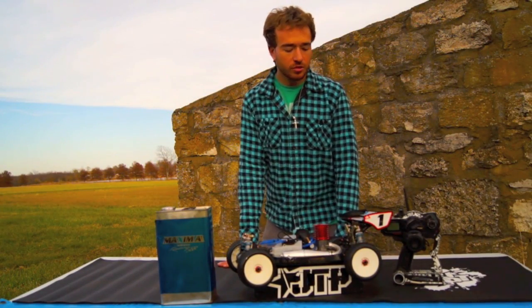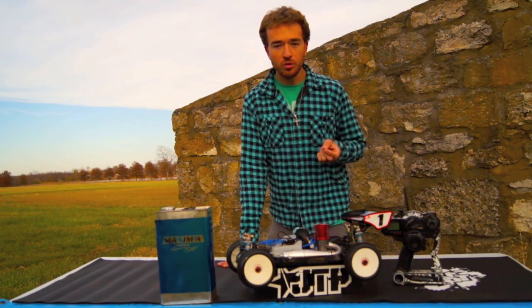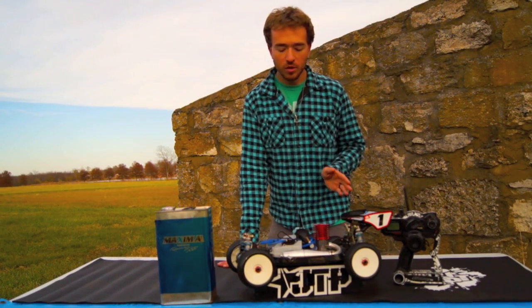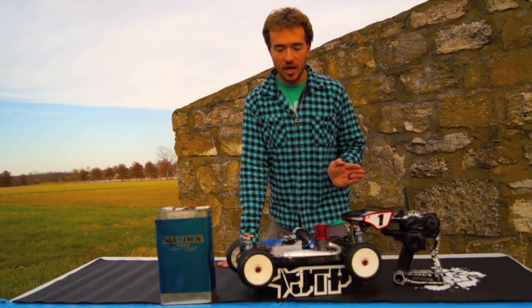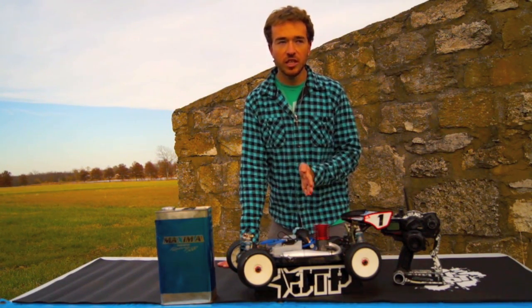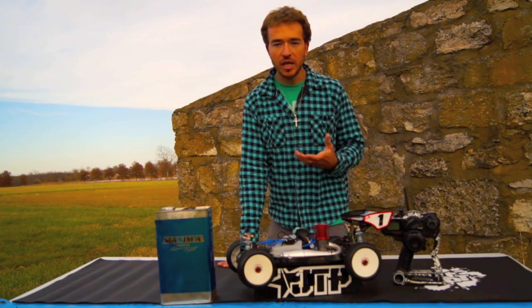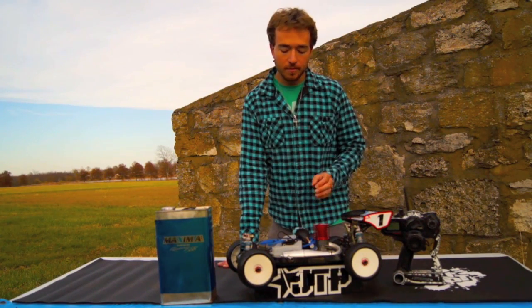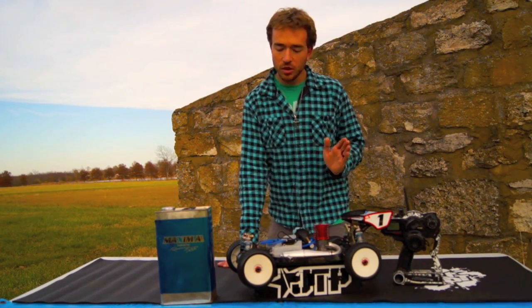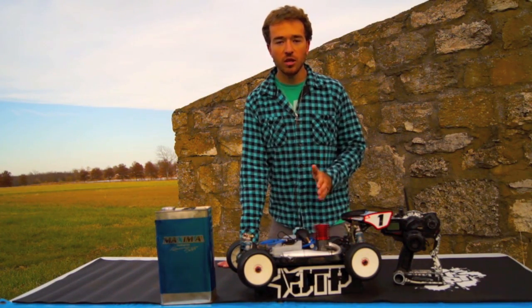One technique that I like to use when it's getting really close to hitting the track is I'll go from neutral to about half throttle. What I'm looking for there is very little smoke to come out and for the engine to have a consistent sound until it gets to about half throttle. Once it's there, it's going to almost get a ping sound, which you may think is a lean sound. But with this fuel, you really want your bottom end to clean out real nice — you can run it a little bit leaner than with any other fuel out there.